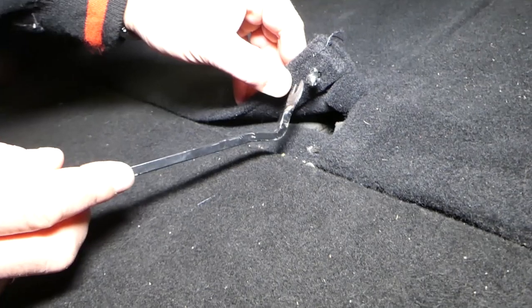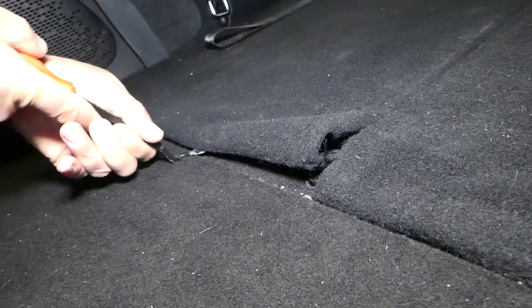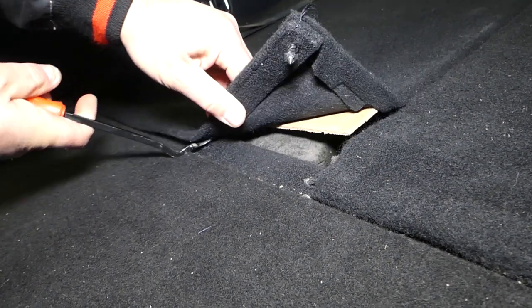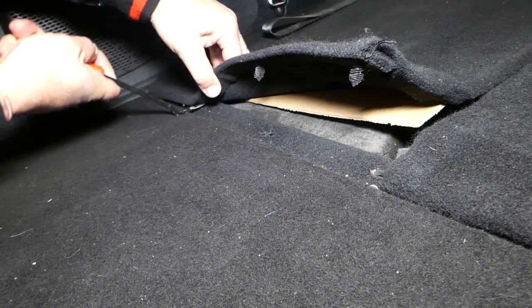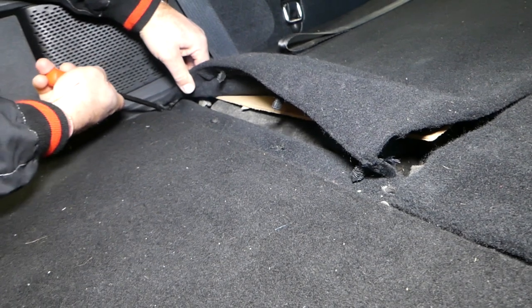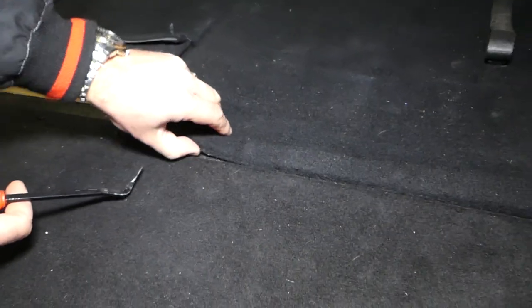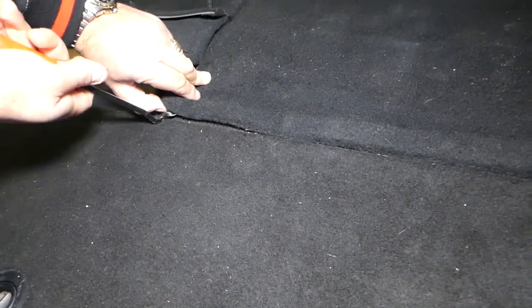So what do we do? Right here we go underneath. You need to get under the clip. You have to be careful not to break that clip, so get it good and just pull them up. Those are replaceable, and we'll show you where we get our clips from. You can check again in the description of the video below. So this one comes up like that. Now we need to come on this side and do the same thing for this seat half.